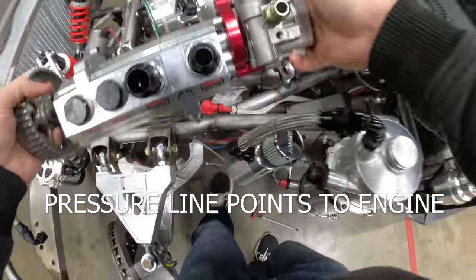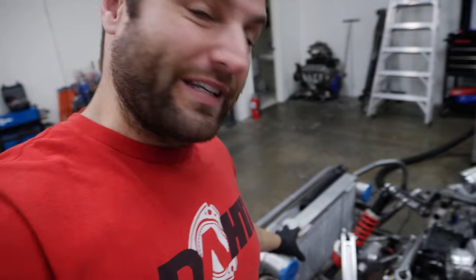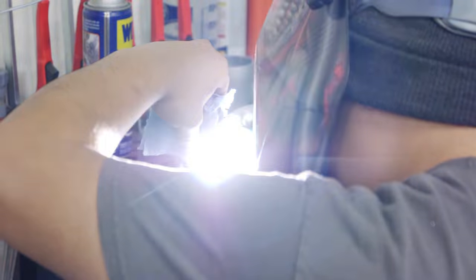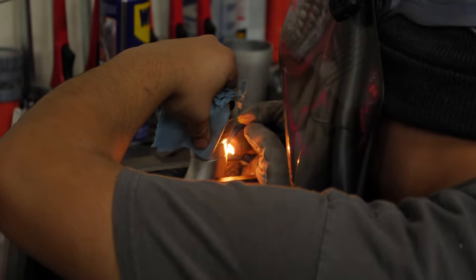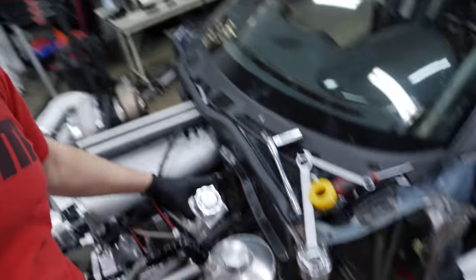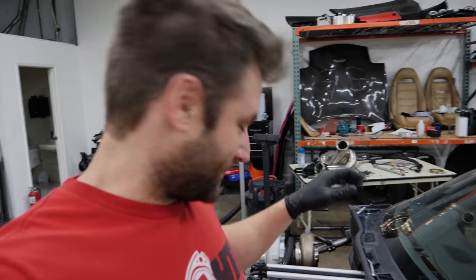I'm not the biggest fan of having a hex drive just sitting on the back exposed, but that's where you can add a fuel pump if you really wanted to. Looks like some sort of gun from Halo. We just got ourselves power steering. As Isaiah is currently welding onto the radiator, he's making it much easier to service the coolant lines — right now they were hitting into the frame — and he's also going to be adding a swirl tank. We're working on finishing up the fuel rails; we have two fuel rails now going to be fed E85. This is actually the same power steering tank used on the Tezza, and we're going to use the exact same thing here. We got the power steering system all mounted up — going to flip it upside down because otherwise it points towards the engine.